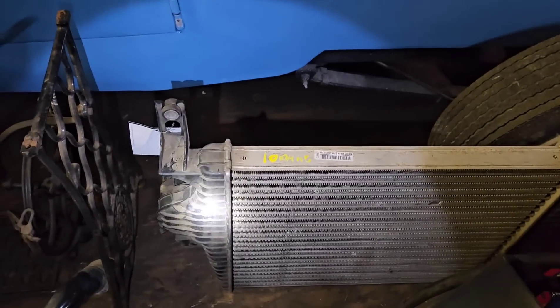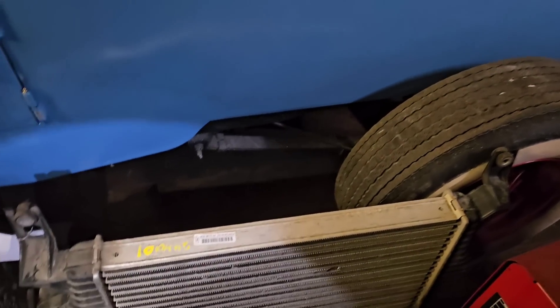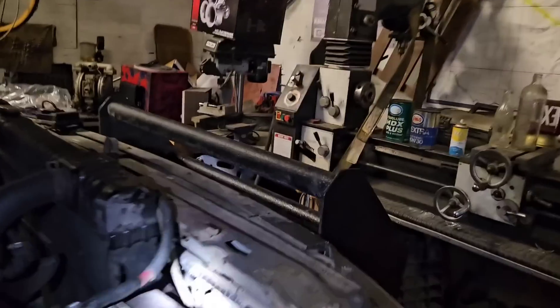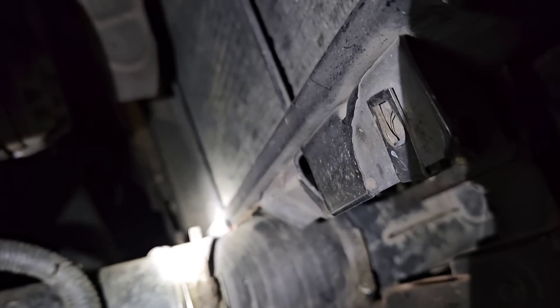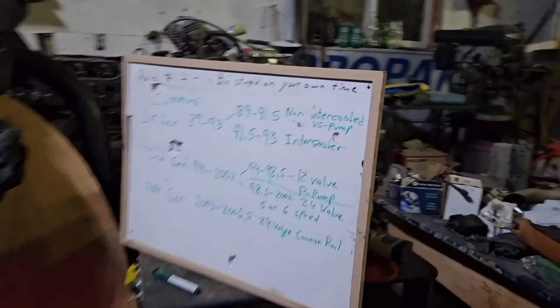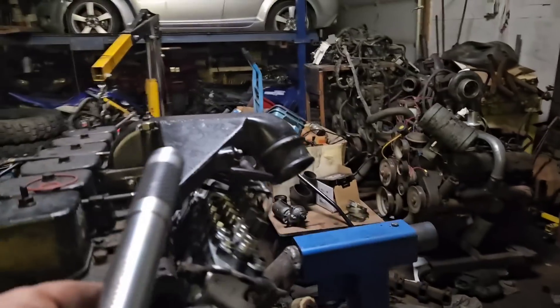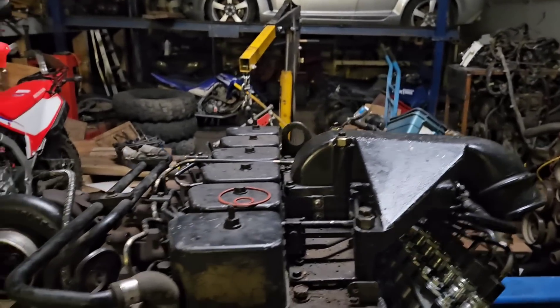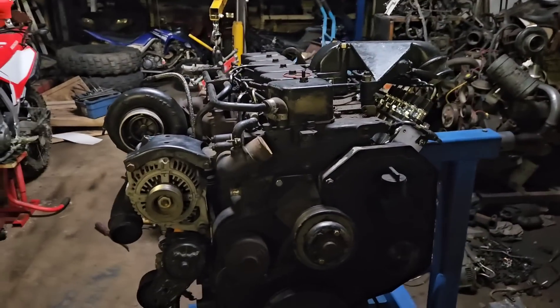They do not bolt right in — they are a struggle. In my previous video, when I put an engine in this truck, I showed that you have to gut pretty much the whole front end to get the intercooler to fit in there. It is what it is — this is the hardest part of the swap. If you choose to not put an intercooler in, you can run it exactly like a non-intercooled model. You can just tie the turbo directly to the intake. The problem is you'll make less power and more heat, deliberately limiting yourself. But it does save a giant step in the process.